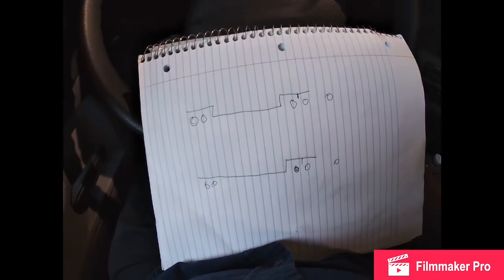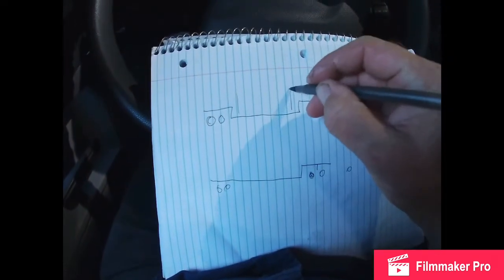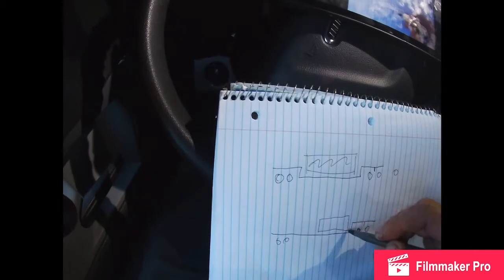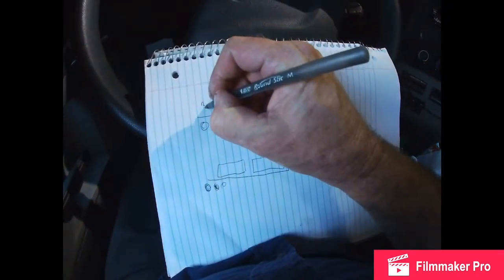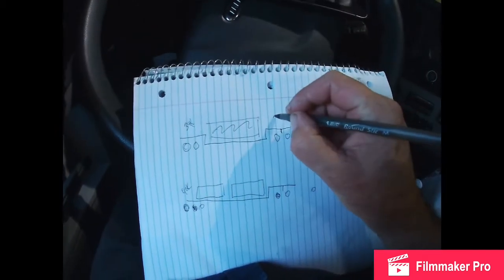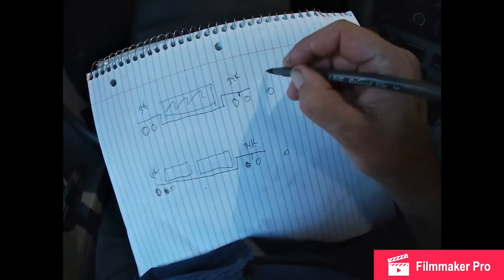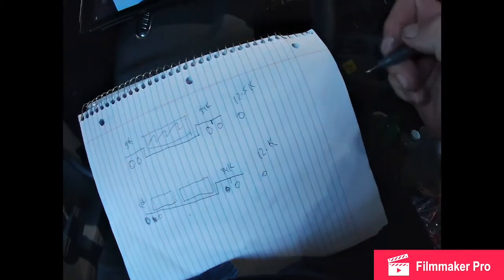Okay, I've talked about scaling before. I'm just going to show you real quick how it's done. This is a DG, the drop deck. Glass sits in here. This is a step deck, which I have behind me now. Glass sits something like this. I can have 34K here. Spread axle, 40K. Rear axles of the tractor, 34K. And on the front, we have 12.5K axles. They'll hold 12,500 pounds per axle.